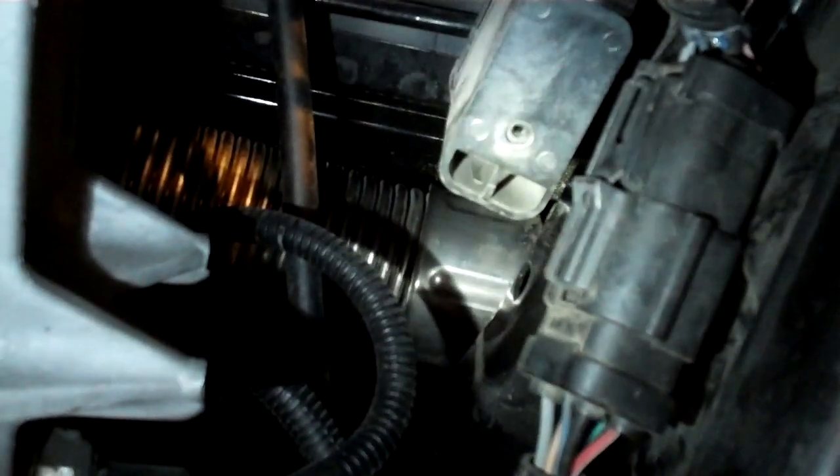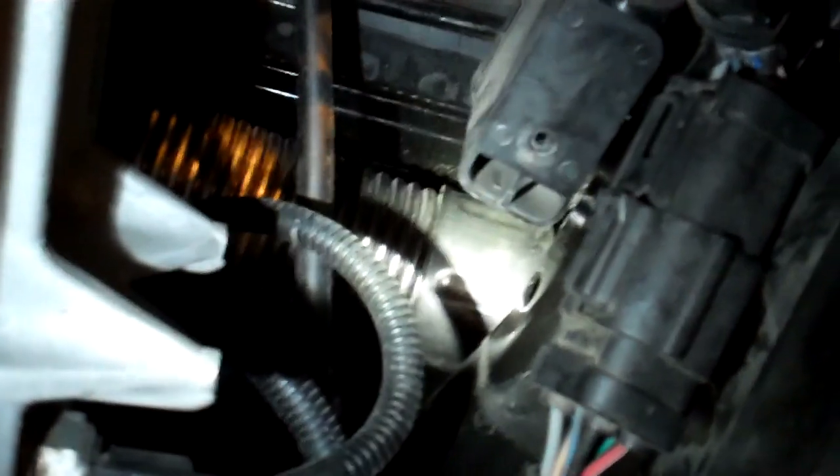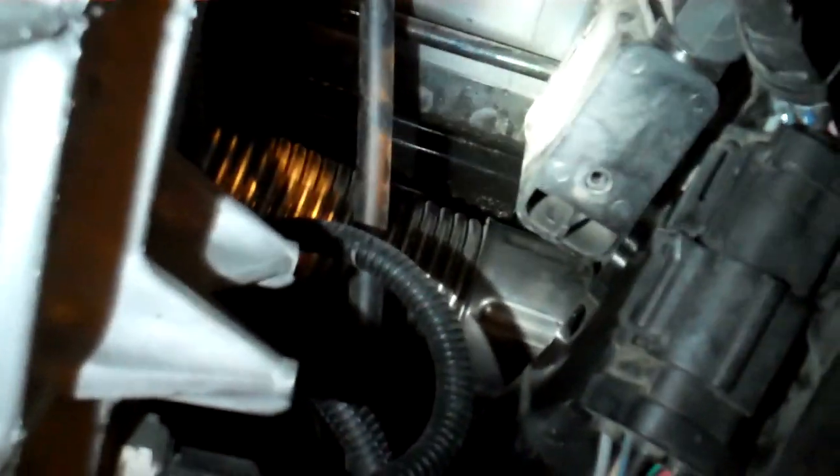One of the links, but the one pertaining to gas, it's the bridge between the 2. So in order to pull one tank out, you have to have enough slack to be able to pull that 3/4 of an inch out of the tank. It's about an inch out of the tank, and so you got to have one of them hanging down one side of the horse kind of far. It's a saddle tank. Yeehaw! We got to have one hanging down so that it'll allow it to pull that bridge over a little bit so that you can get it off.